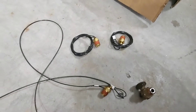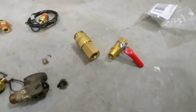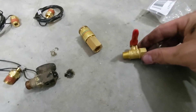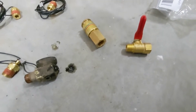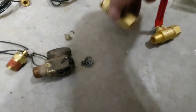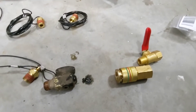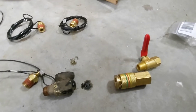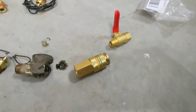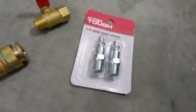Here are the other two of these I have — I just got these off Amazon, they were fairly cheap. The last thing we're going to do is replace that International-specific service port with just a valve. You can get these at any hardware store or on Amazon a bit cheaper. These are just a quarter-inch plumbing fitting — male end on one, female end on the other. This will screw directly into the tank and provides an on-off valve. Then I'll put this quick-connect fitting on here with a little thread tape. This is the Milton style, also known as a quarter-inch MNPT. It's just a quick-connect, so I don't have to thread a hose on there — all of my air hoses and tools have these quick-connect fittings already on them, so they just snap and lock in, then snap release.